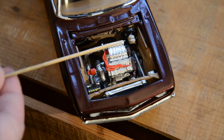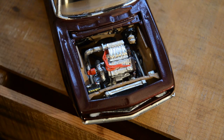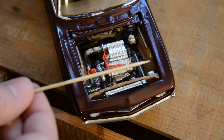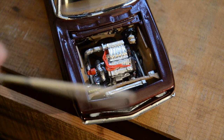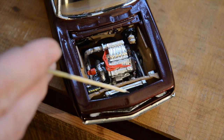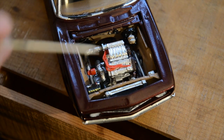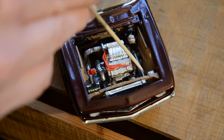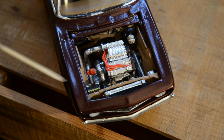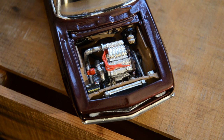The way that the drive shaft fits and everything, and the way that front suspension lines up there, you can see that it forces that motor to sit a little bit farther forward. So that's been moved up. And then right down in front of the radiator here, there's an intercooler. And all of the piping has been run all the way back on both sides here. So you can see right down in there, there is some of your intercooler piping. And then also right here, you can see some, which runs right to the intake manifold.